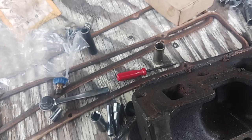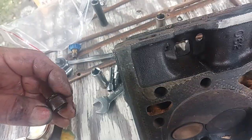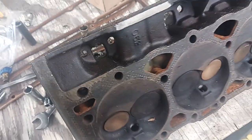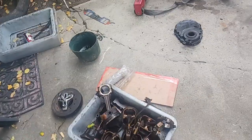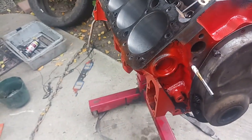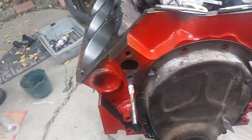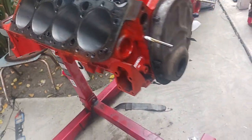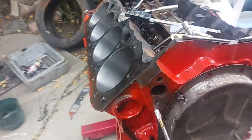I'll replace the seals — I think they're called Manley, or Maui or whatever — they look identical to the original equipment. I will be replacing the springs; I'm going to get the Z28 springs, they're good for a mild lift. The lift on this will be like 450 on the exhaust and 430 on the intake — nothing extreme. It's basically a cam you'd put in an off-road truck, a good torquer cam. It'll be good for burnouts around town, but once it hits about 5500 RPMs it starts to die out, so it's not going to be a race car.